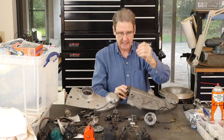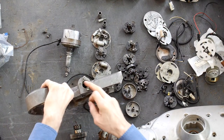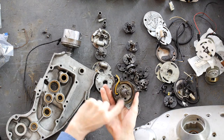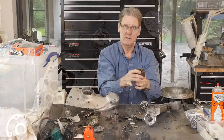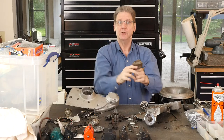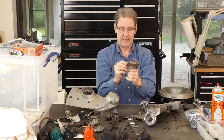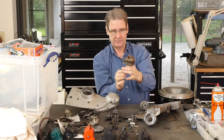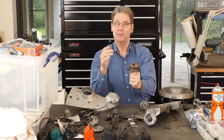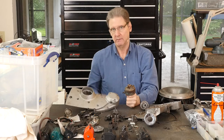It's got this little gasket here, and the theory is this little gasket goes down on this boss here. It's got two holes for these two screws. This base part here is screwed down hard. Doesn't swivel at all. A cable goes in here, up to your left handlebar, which used to have internal cables in them up until 64 or 65. You could turn it, and when you do that, it rotates. I'm holding the bottom steady but the top part is moving. The gear, of course, isn't going anywhere — the bike's standing still.